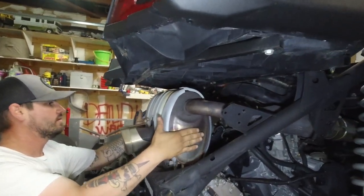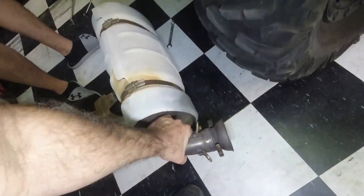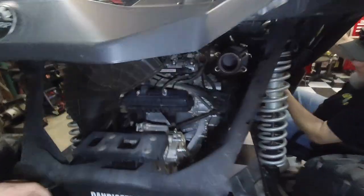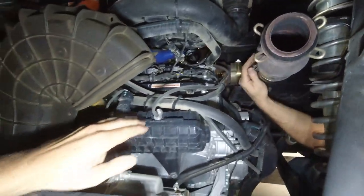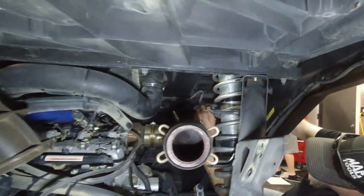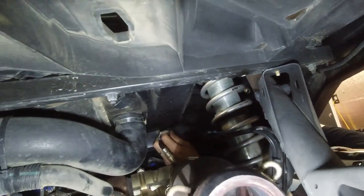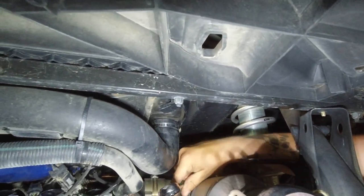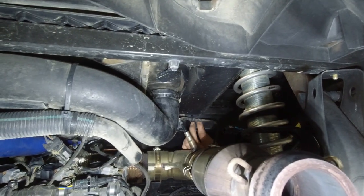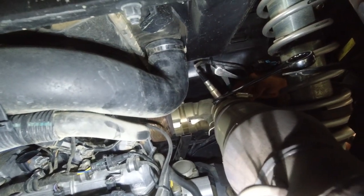Look at the space! Here comes the big moment when the stock exhaust comes up. This thing's heavy. Just put the EVO one on here - you don't need the cat delete. It's too bad we don't have the injectors right now - look how easy it would be to get to those. Take my sensor off. We're going to take the O2 sensor out right now, then we're going to take this loose from the perch, then we're going to bust the V-band loose.